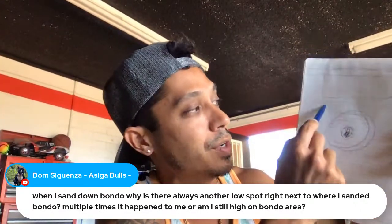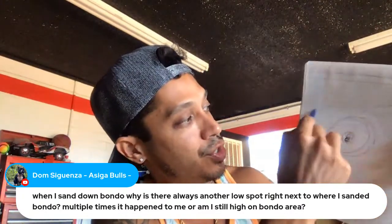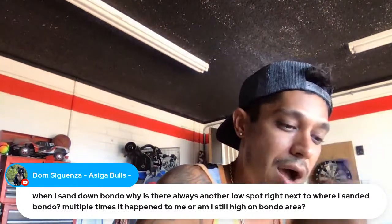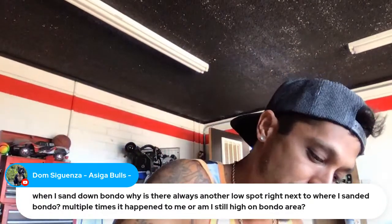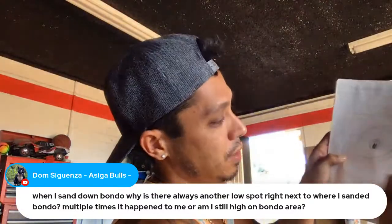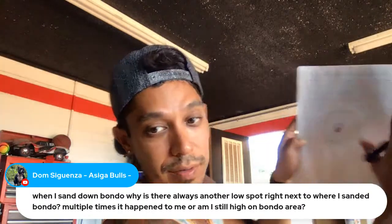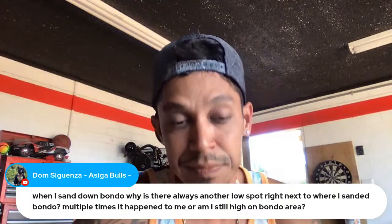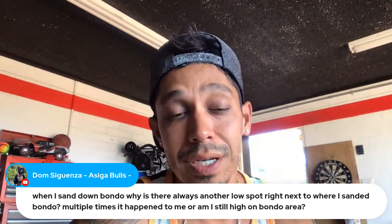You want to tap here, and then you're going to basically grind the whole thing, right? And you're going to put a skin of body filler. My pen doesn't work. But you're going to lay your body filler over it this way, right? And then you're going to block it out flat. If you're having issues, I would definitely use a guide coat.